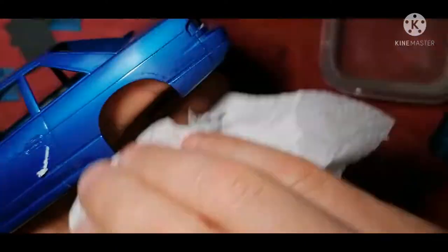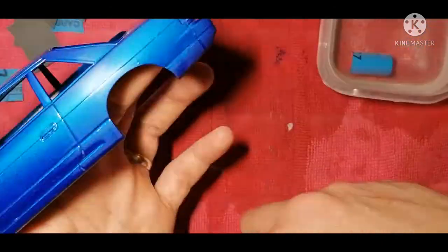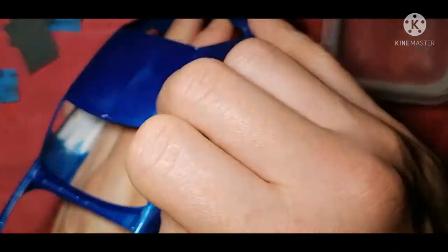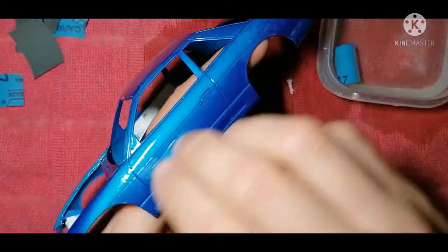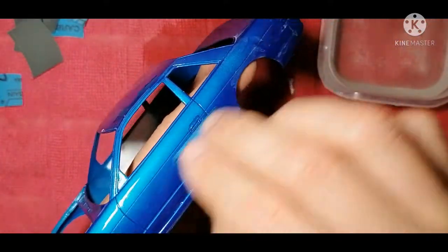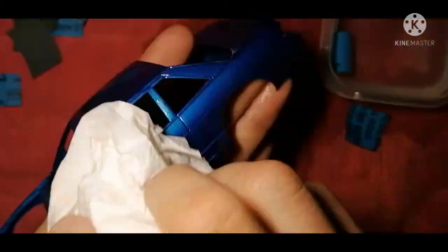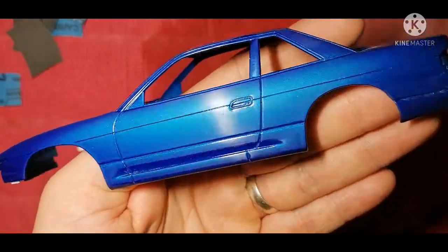When I first started I was drying so often because I was so worried about burning through. There were quite a few times I burnt through — I actually burnt through on this one, just on the back where the rear arch and bumper meets, a tiny little raised lip of burn-through. The trick is to stop and dry and check more often than you sand. Don't apply any pressure — take your time, put some music on, relax and enjoy it.